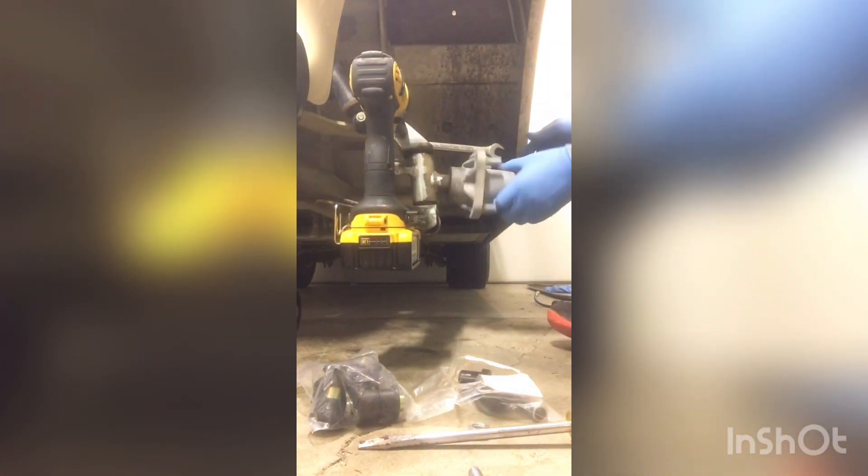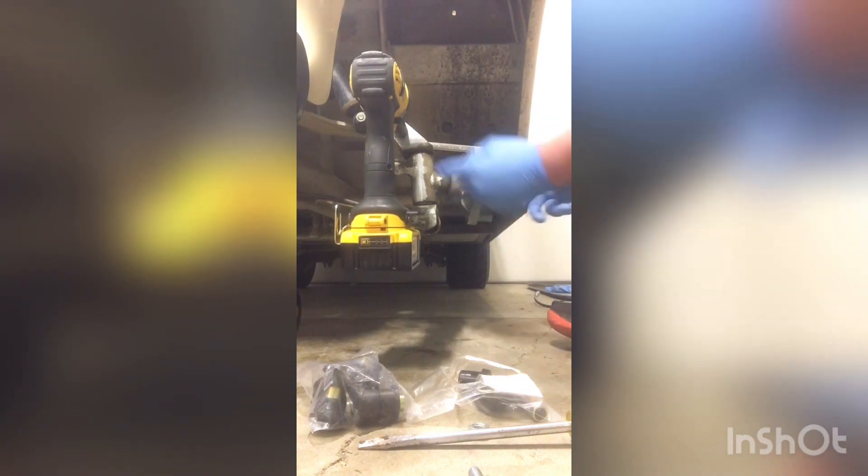The bushing is gone here on the bottom, and it's causing all kinds of noise. When you hit bumps and things like that it wants to kind of jump around. I already zipped the wheel off. I've got a 9/16 impact socket on my impact driver and a 9/16 wrench. That one seems loose already — I already put WD-40 on it. Looks like someone's had this apart recently. This is a new hub and a newer spindle — way newer than the other side.